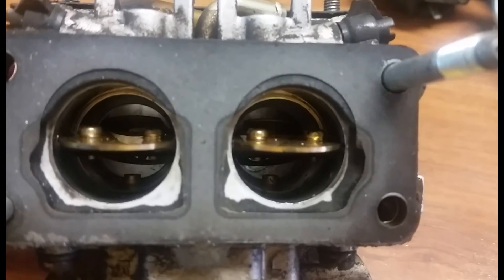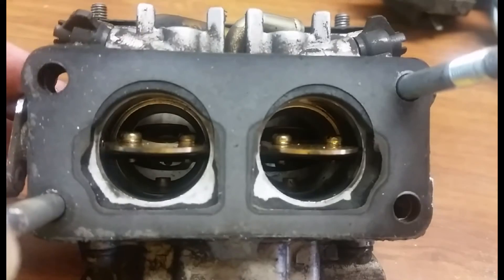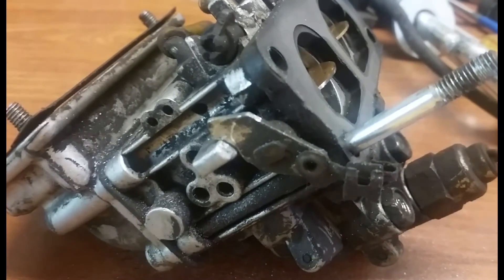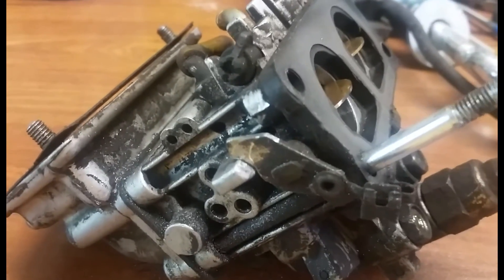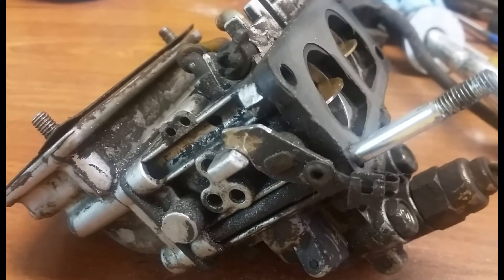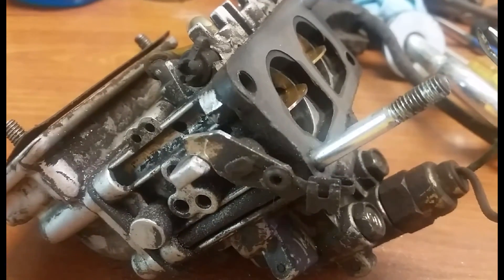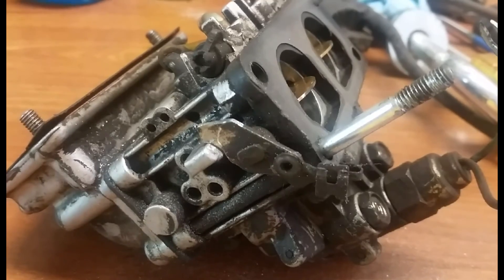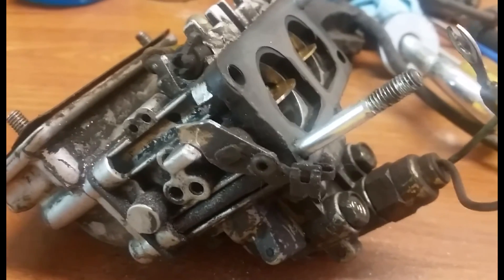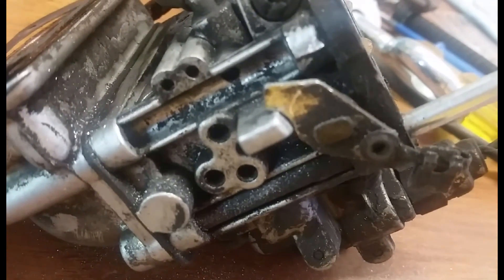All I need to do now is assemble everything, put it all back together, and see how it works out. One more thing to be aware of: you can switch to a 25 horsepower carburetor, which is just fine. But to make it a true 25 horsepower engine capable of sustaining that power long-term, you should also put an oil cooler on. There are three parts: an o-ring, what they call the standpipe, and the cooler itself. You can reuse your same oil filter, but you should upgrade to the 25 horsepower oil cooler as well. Good luck — easy modification that gets you two horsepower. Hope it helps!